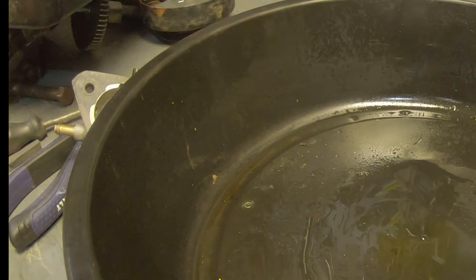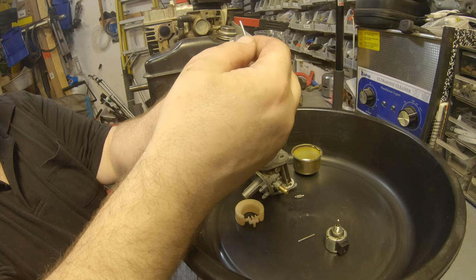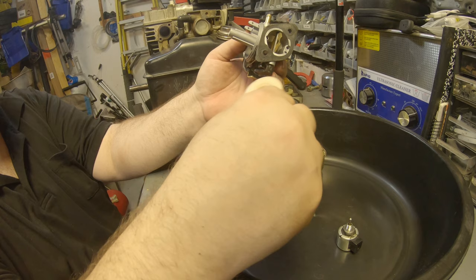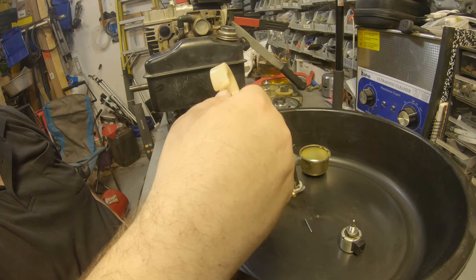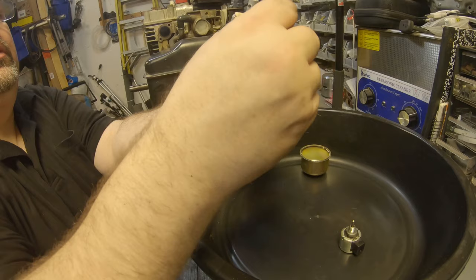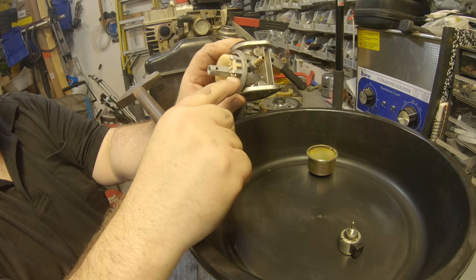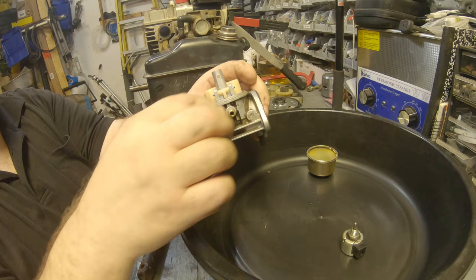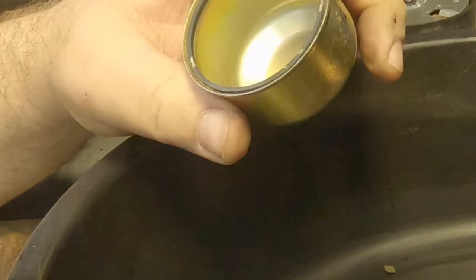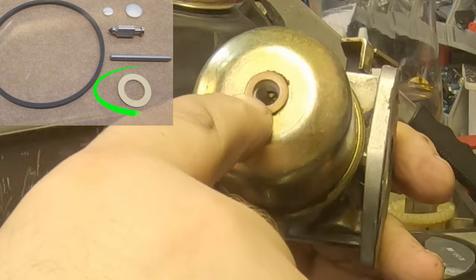So we'll put that back in and put this all back together and get this thing back on the mower. Get that pretty snug in there so it doesn't vibrate out. I'm going to go ahead and use this new pin. Another thing to check when you got this apart is kind of shake your float a little bit — make sure it doesn't have any fuel in it. If these get cracked, they'll fill up with fuel and they won't float. Put your needle back down in there, make sure that slides down in there. Put your pin back through here, centered so your bowl fits all the way on. I'm not going to replace this bowl gasket — if it leaks a little bit I'll pull it apart and put a new one on. Make sure that little gasket is still on there.